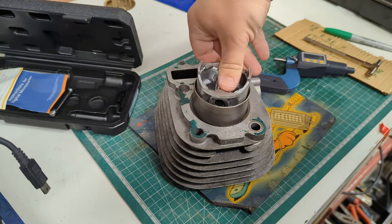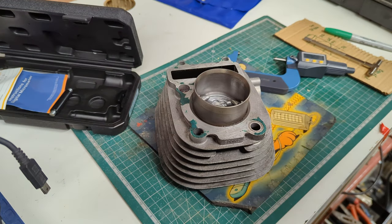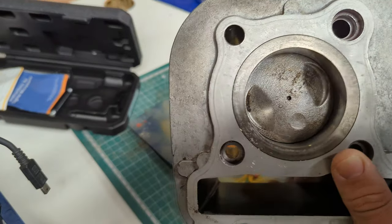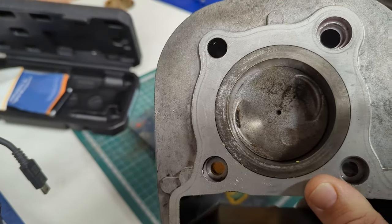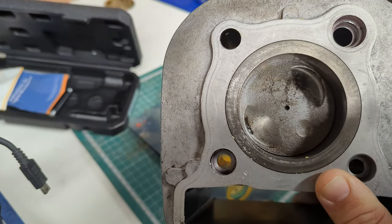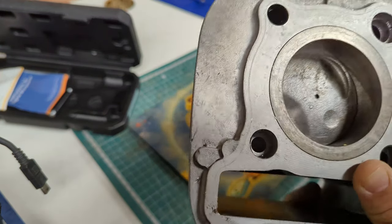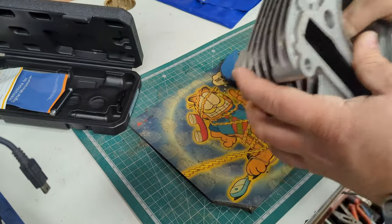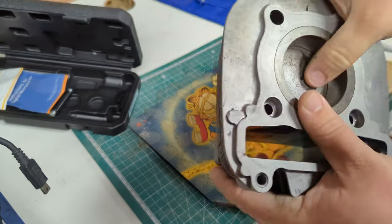Just for those who wanted to see just how worn out this is — that's how worn out those rings were, not seated properly. And if I pick it up, you might be able to see the gap around the outside of this piston. I'm rocking it now with my fingers, but there's a distinct click-click. Very definitely out of spec and really easy to move.